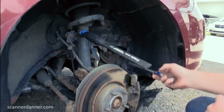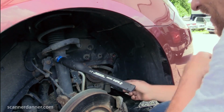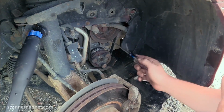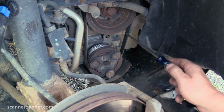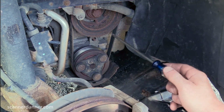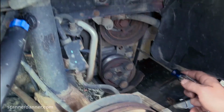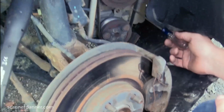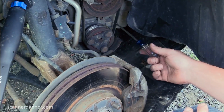One of the things that I did not consider when we were talking is this has a separate belt for the AC. So here's my crank pulley, here's my AC clutch, and it uses a separate belt. Because I saw the serpentine belt spinning at the top, I just assumed it was on the same drive belt. Remember we just did that alternator job in the driveway, Caleb, where we were missing a belt. Yeah. Well, we could have had the same problem.